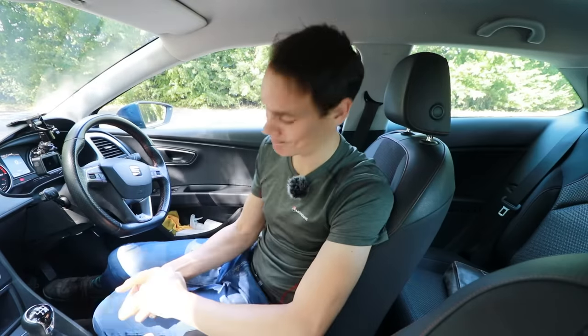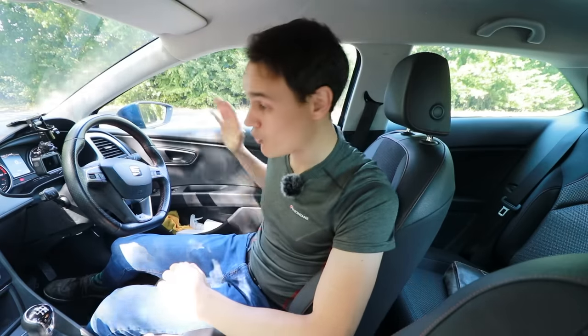How do you do it? Push the clutch down, put it into neutral, come off the clutch, then blip the throttle exactly how much you need to rev match the gears - that takes skill. Then clutch down, put it into the lower gear. Then before coming off the clutch, if you want the smoothest gear change, rev the car again to rev match the clutch, and then come off the clutch. So you're having to rev match the clutch and rev match the gears.